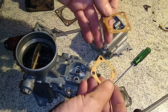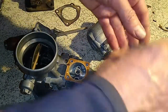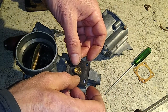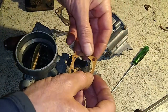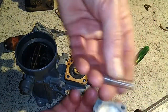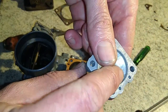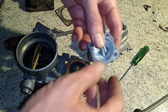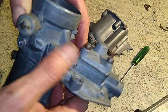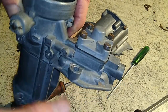Assembly of your economy valve is pretty straightforward. We've got a gasket here, the economy valve drops over there, another gasket onto that, then the housing on top — but don't forget the little spring in it that pushes down. You've got your little port through here which feeds from the little brass port there. It's held in place with four screws. So the economy valve cover: four screws, paper gasket, rubber diaphragm, paper gasket on top — and you're done.